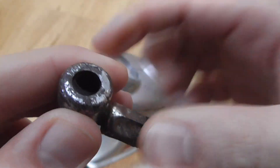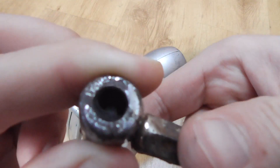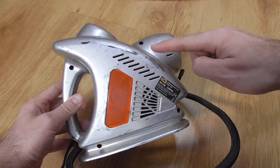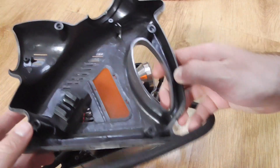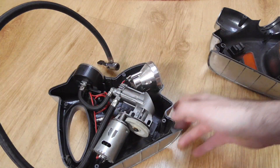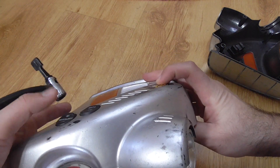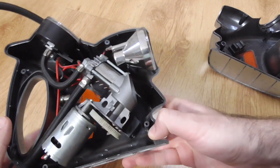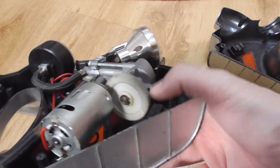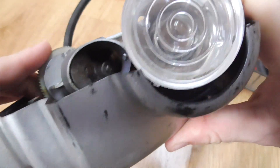The rubber is here on the side, but when you push down it squeezes and pushes out the center element. I already removed four screws — that's what is inside. Here's the 12-volt plug for the car, which comes in and enters the switch. That's the motor and the compressor itself. That small diameter shaft is rotating a larger wheel, so the RPM is reduced and torque is increased.